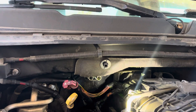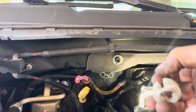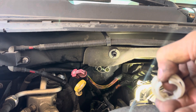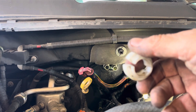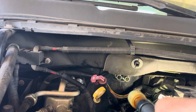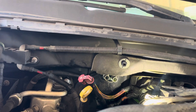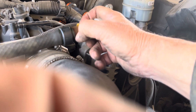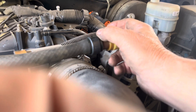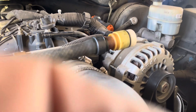To get those off, you use this right here — this is a three-quarter inch tool. What it does is you slip it in behind those fittings, it opens up like that and pops up on that tube. When you get it in there, you need to twist the hoses or fittings a little bit to make sure they're broke free. It goes up behind, pops in, pushes those ears out, and then you can pull the heater hose off.